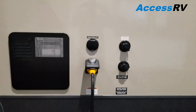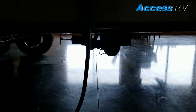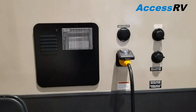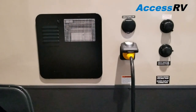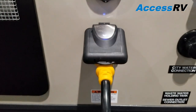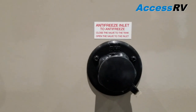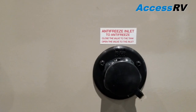Back here is your power and water connections as well as your dump station. This uses a six gallon gas and electric DSI water heater — really easy to use. Just flip a toggle switch for electric or for gas and your water is going to start heating up. Detachable marine 30 amp power cord. And just above the city water connection, they use a quick antifreeze inlet so that winterizing is really quick and easy. You don't have to go through a lot of the bypasses like with other RVs.